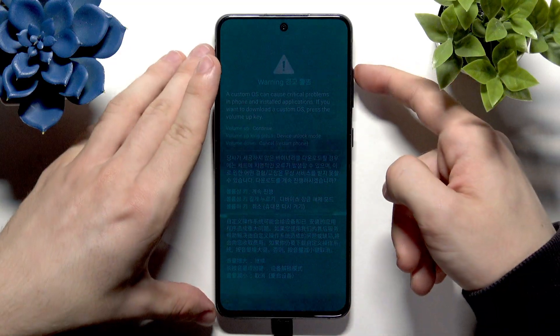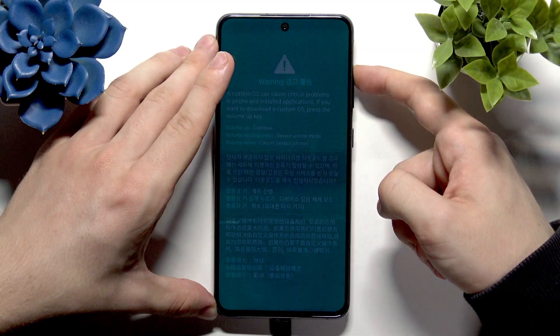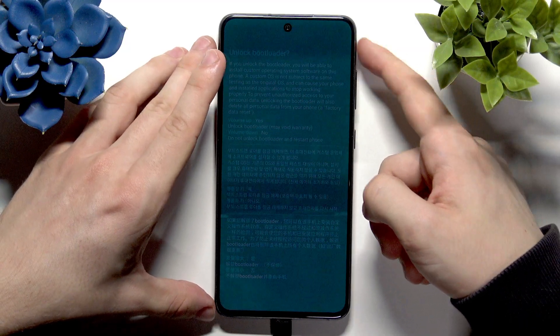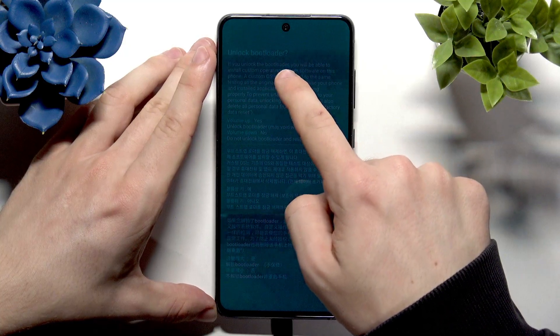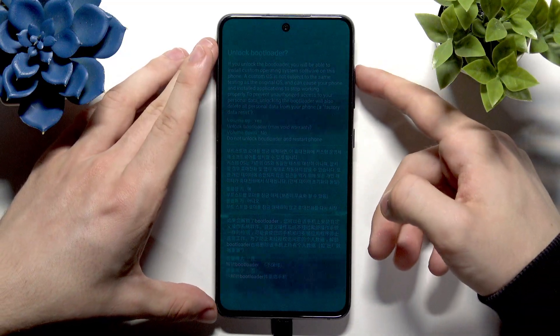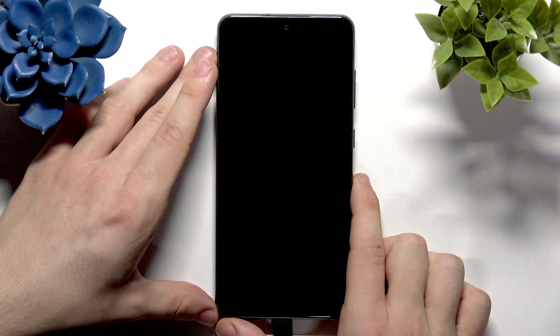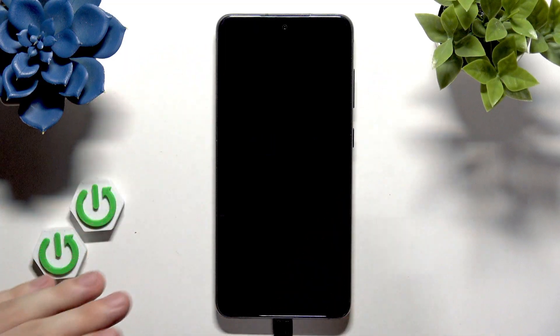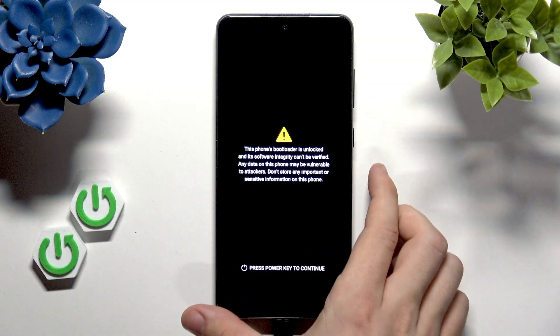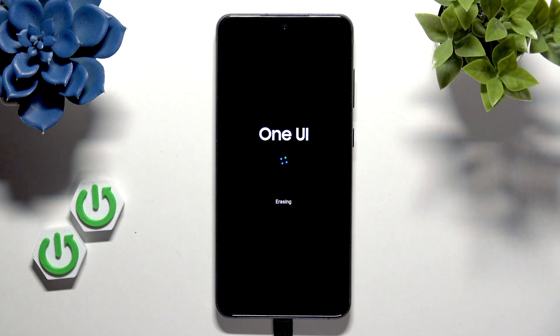What you should do is press and hold on volume up. Once the screen goes off, you can release the button, and now it says unlock bootloader. If it says unlock bootloader, then click on volume up to say yes, and now the phone will reset. Press on the power button to approve. It'll reset all the data, then it'll restart, and it may take some time, so get ready for a little wait.